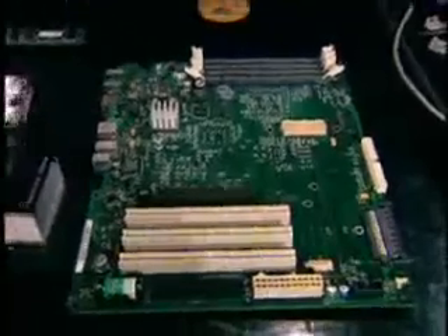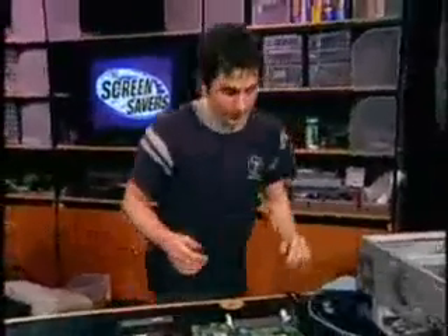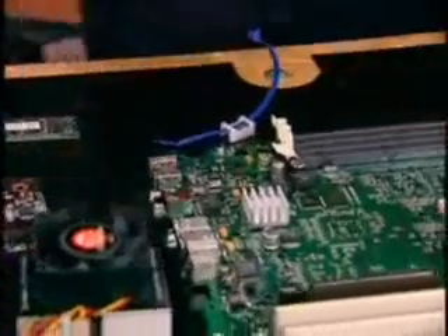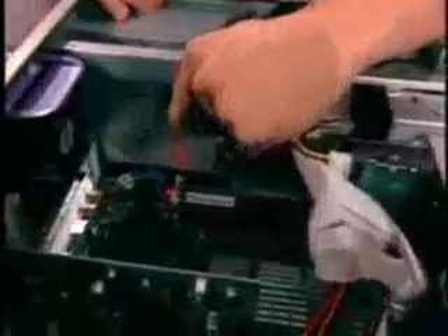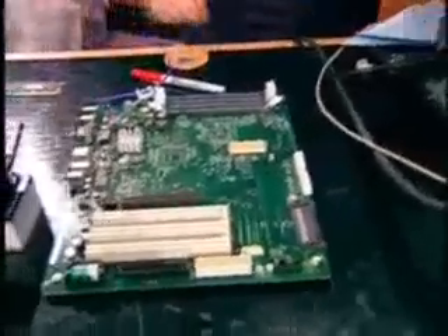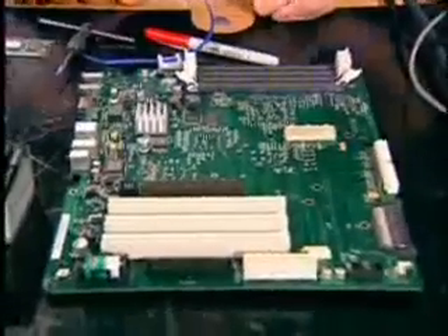You would actually have to pick up additional motherboard mounting hardware. What I did is I picked up one of these little plastic pieces — I screwed that into the ATX holes on the case, then ran a zip tie all the way through one of the holes in the corner of the motherboard. So you zip-tied the motherboard into the case. There's the actual zip tie in place holding the motherboard in. Another option: you take the motherboard, hold it in the case, take a red Sharpie and mark all the holes on the case. Then you take a tap, drill a small hole, and tap it in — creating actual screw holes to hard-mount the board to the case itself. Better than using zip ties.